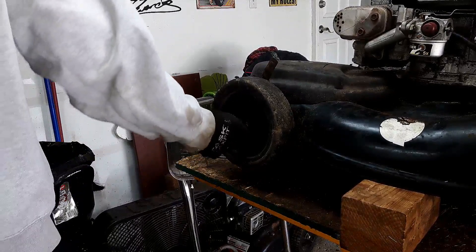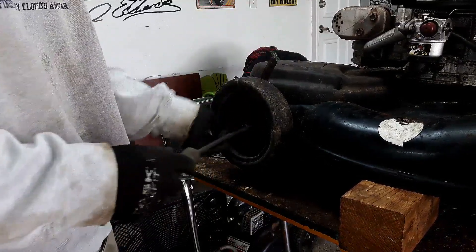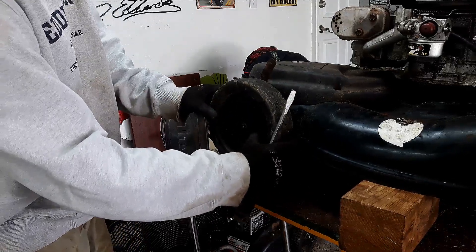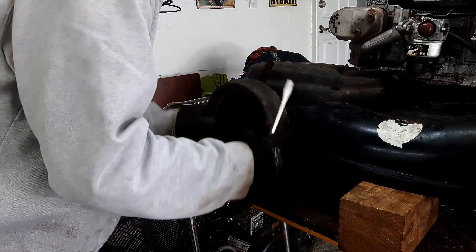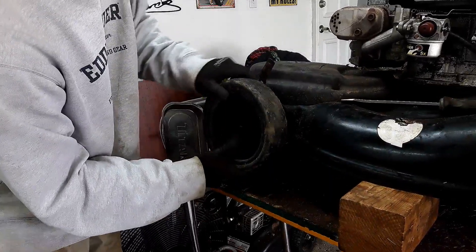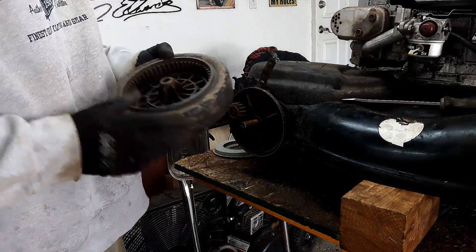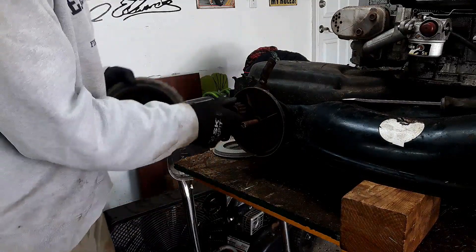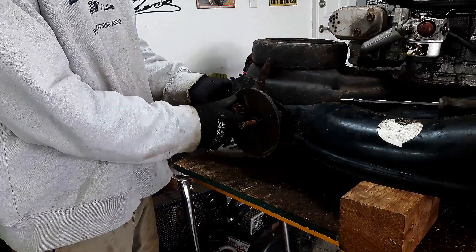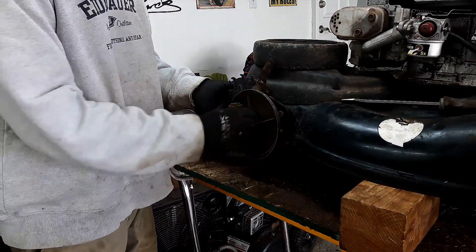This front wheel is a little bit different — it's got a cotter pin in it. I'm just going to take a flat head and grab that cotter pin out. It's got a flat washer. There's usually a whole bunch of other washers and stuff behind this. So just be careful when you take it all off. This self-propelled wheel is in pretty much perfect shape as far as the gears are concerned, but that gear is creating some resistance when I'm trying to walk with it. So what I'm going to do is try and get this gear off, and then it will just spin freely on this shaft.